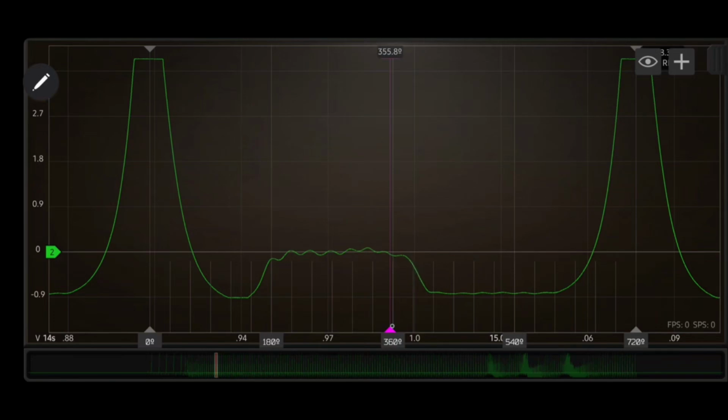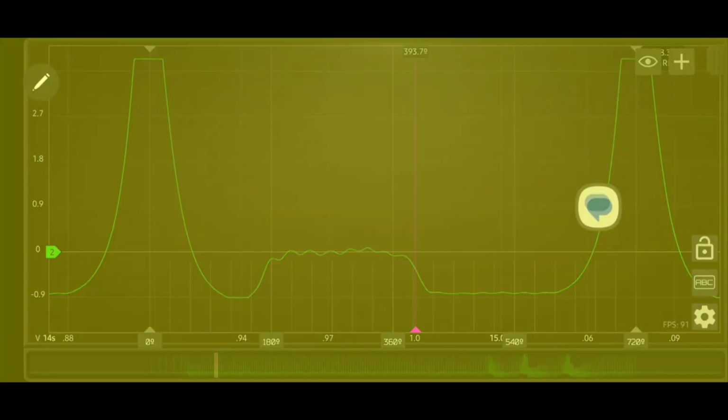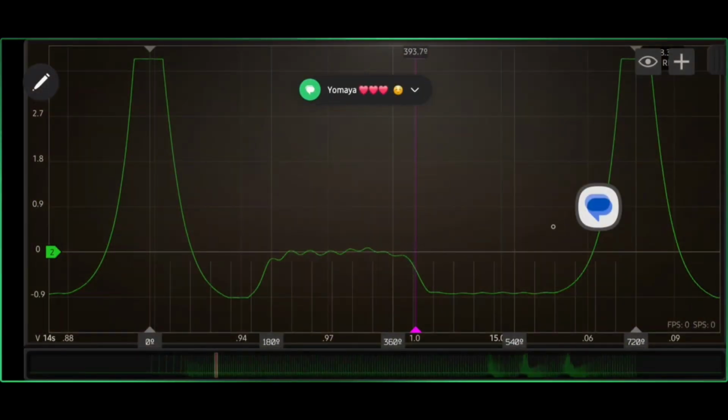So as you can see, we are definitely advanced on that, because what we got here, we got 300, and we're going to say 397 degrees to about the center. Well, we'll give it a little bit better. Do like 395 degrees to the center, and it should be over in this area somewhere. So we're 380, so we're about 15 degrees. We're going to say that's actually retarded, because that's actually moving too far to the right. Anything to the right of the screen is retarded.